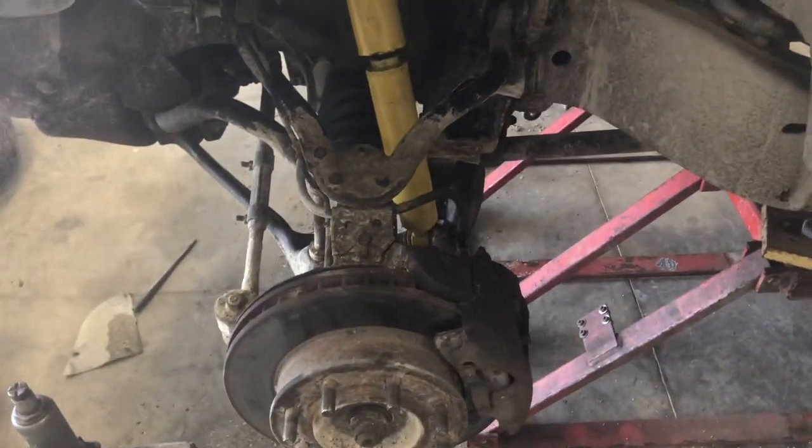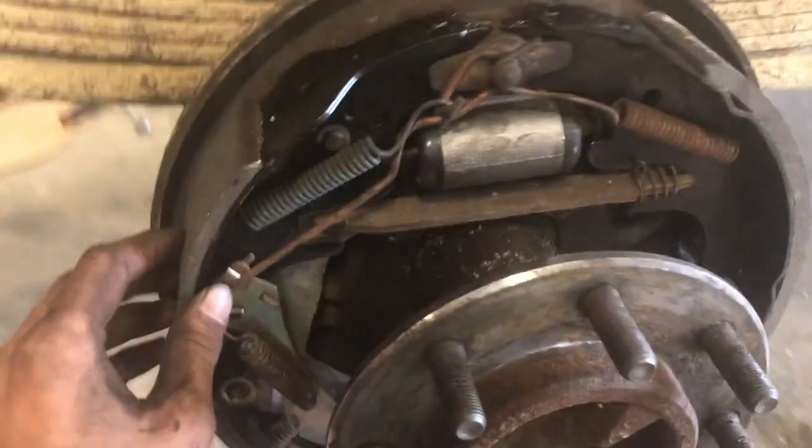Alright, serious note. This is what I've done so far. Put the front shocks in. You have the pickle fork bent up, the new ones. We got that one in. The bleeders are soaking, so we can bleed the brakes. 2 wheels of black, 2 of them are at home. The other shocks in. Put new rear shoes on.